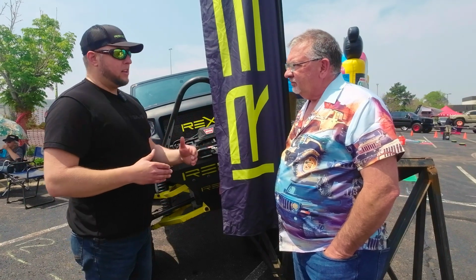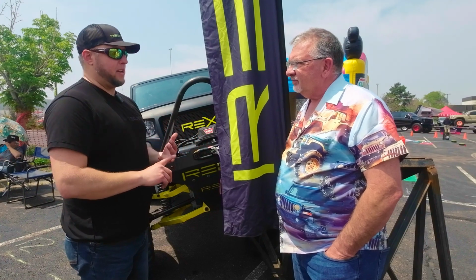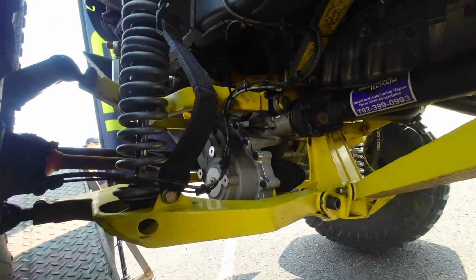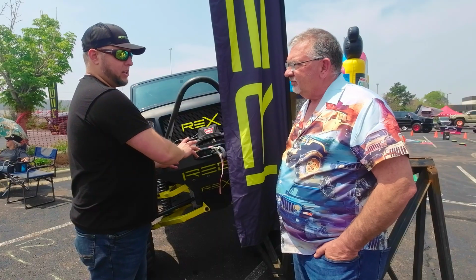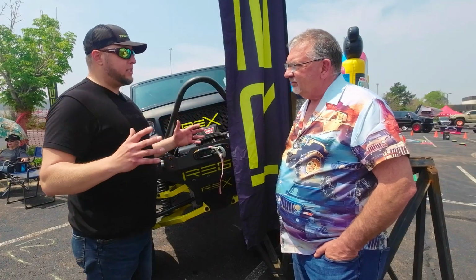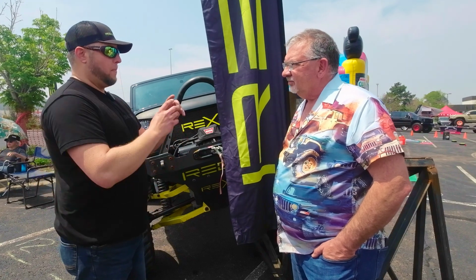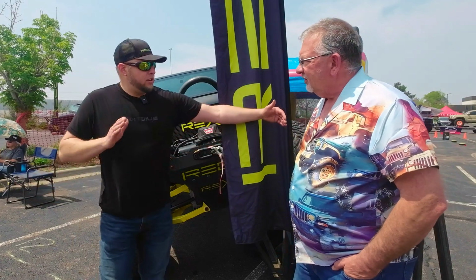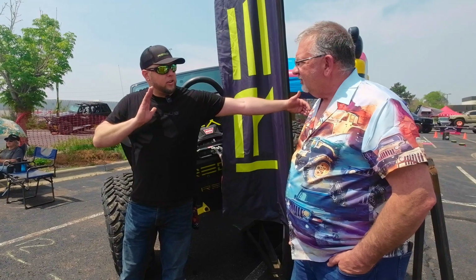And then up front, what you do is you essentially take the guts, the differential, the ring gear, the pinion, and put in a new install bearing set, and it's going to give you your Dana 44 directly into this new aluminum cast housing. And then on the outsides of the aluminum housing are essentially portal axles. So you get a 3-gear portal, and it makes the drive shafts so that they're going all the way across the vehicle, essentially cross car, right?